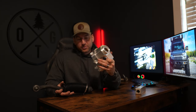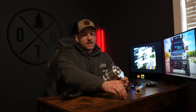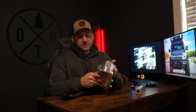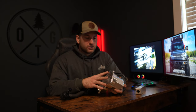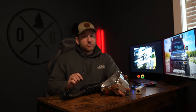The solution I'm choosing is the upgraded Icon tie rods and a steering rack end cap from 74 Weld. This piece is billet aluminum, it's really light, and it is gorgeous. This is so much stronger — billet aluminum and thicker — as opposed to thin cast aluminum. This is a drastic upgrade from what comes stock and will alleviate a lot of the breakages you see. This piece alone is a thousand dollars, so this is not a cheap solution, but it is the best, most reliable solution.